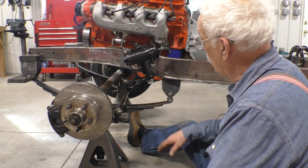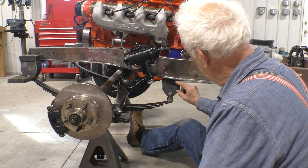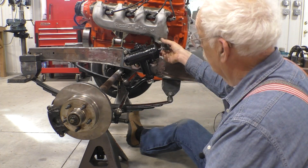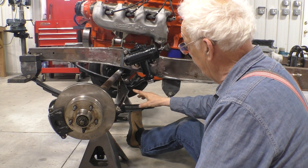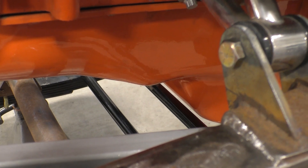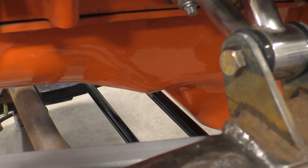Another modification we did was increase the space between the frame and the spring. This is a gasser so we want the front end up in the air — we hadn't planned on doing it just yet, but we found that if we put two inches of height into the vehicle we gained plenty of room between this nut and the spring. The way it was, if you turn the vehicle slightly to the left, the pitman arm positions directly over the spring and bouncing the front end could get the nut to touch the spring. With the additional two inches, that's not going to be a problem. The last project on this list is to modify the oil pan for more clearance — I've already ordered a bump-out oil pan so we don't lose any oil capacity, and that's certainly a subject for a different video.